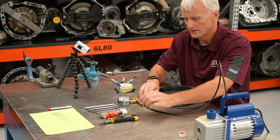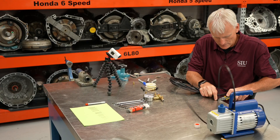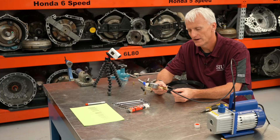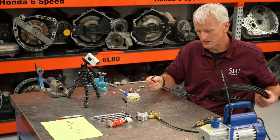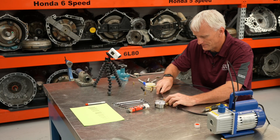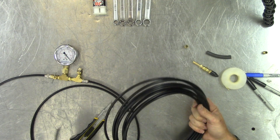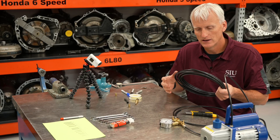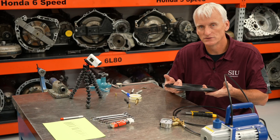I'm going to go ahead and make this connection with my hose — push this quarter-inch line down into that push fitting. This push fitting on this vacuum pump is not very good; they were really cheap. The ones listed for this video with the 1/8-inch pipe thread metal ones are really good by comparison. Now I'll cut a piece of hose to use to test the transmission. As you can see when we're done, we've got some extra line for pressure testing, a couple extra push-fitting connections — so even though this stuff costs a little money, you're still left with extra components you can use elsewhere.